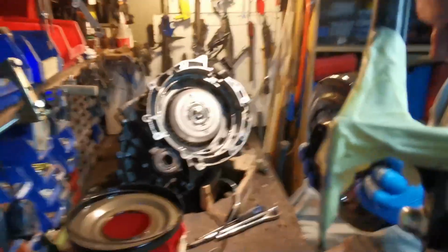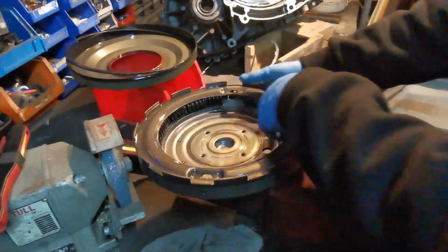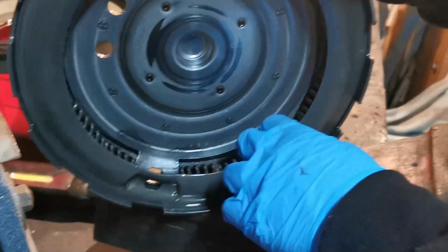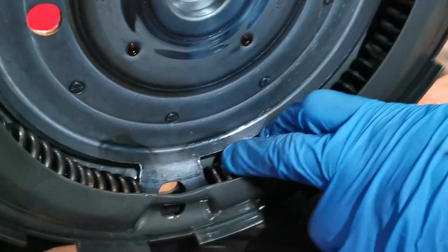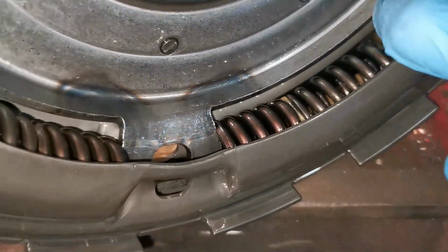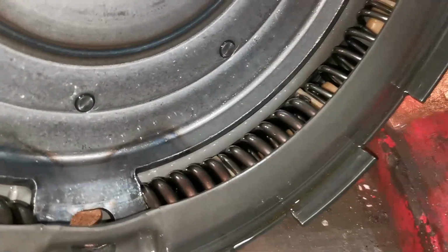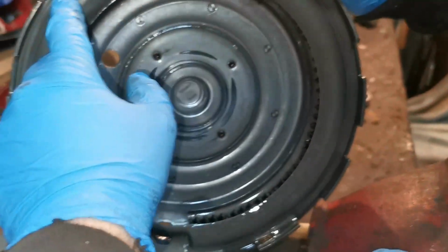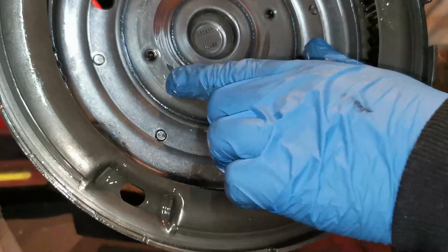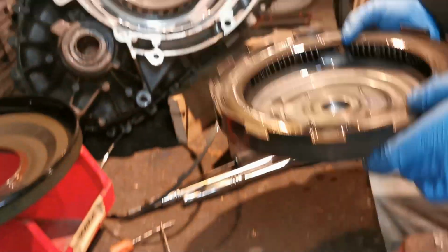This shouldn't have that much play. So basically, last time I did the same repair, and that was in the gearbox from a diesel C-Max, and I was replacing these springs and all these white dividers, shims, whatever they're called. I had a big circlip all around, so I could take the circlip off. There's something wrong going on because it's been shaved. That's bad.